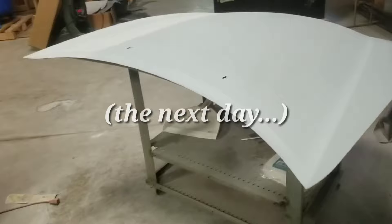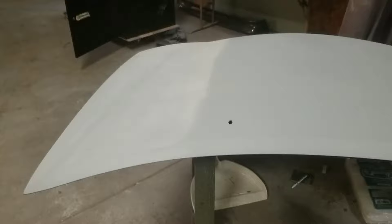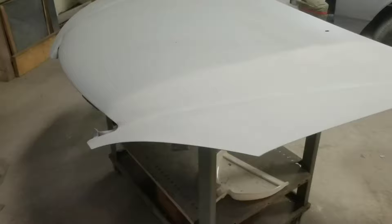This is day two and this is where I left off. I started sanding over on this side last night. This is the second coat of primer — it went very well. I'm going to sand this down with 400-600 grit sanding film and then lay on the base coat. I've got enough primer on here; I don't want to go overboard since it's really just a new hood — just enough to protect the metal and give the base coat something to stick to.